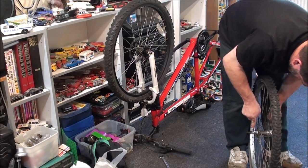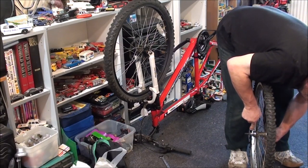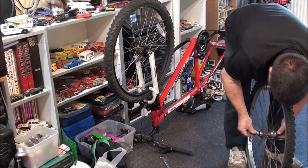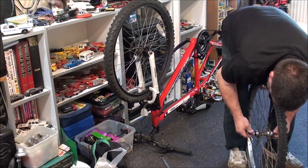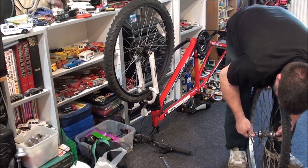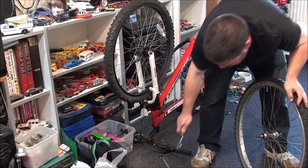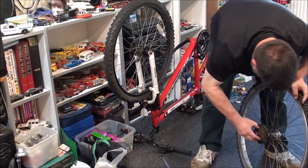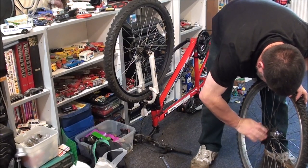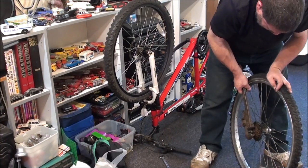That's a joke, isn't it? I've loosened the bearing cone on the axle, which wasn't helping. That's much better though. I'll spin that back on — that means it should coast a lot better than it was.